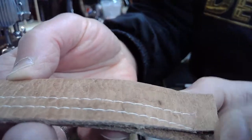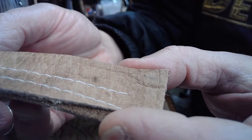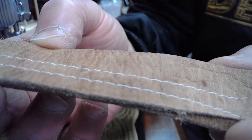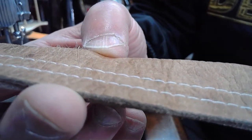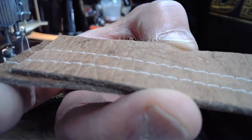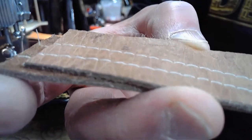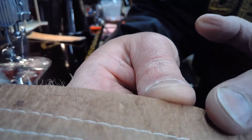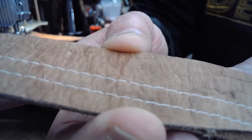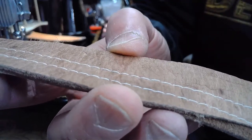Look at it like this too. See again on the end there, what we just sewed through without a hand start, without the benefit of a leather needle. We just went through about 14 ounces of genuine elk hide. And even before we made the adjustment, this again is our lock stitch on this side. Even before we made the adjustment, we had a really decent looking lock stitch. When you're managing this much leather with a non-leather needle, you don't expect to get results this good.